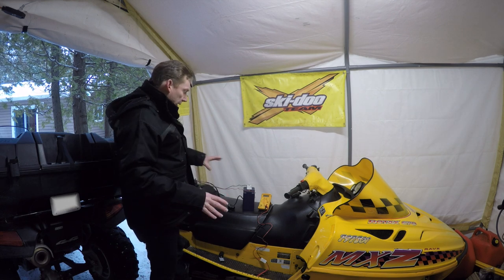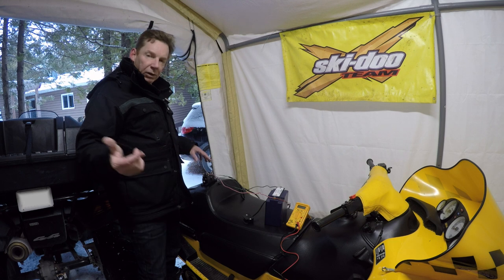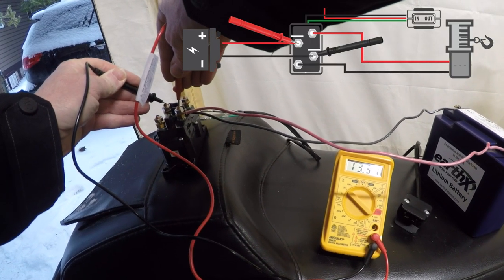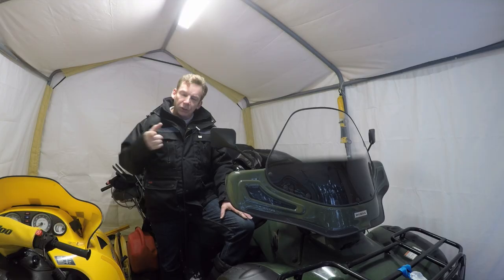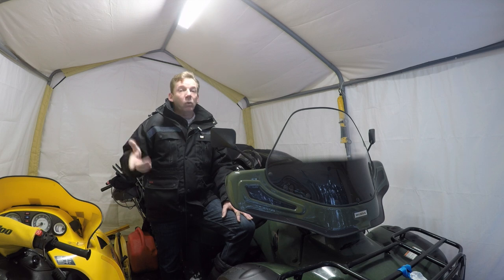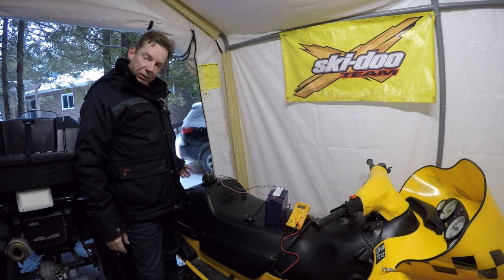These components are going to be installed, but you've got your battery, your solenoid, and your switch. The first thing you want to do is check the two terminals where the lines come in from your battery. Regardless of where your switch position is, at this point we're in front of the switch, so we should have about 13-point-something volts across these two. If you don't have 12 volts getting to the solenoid, that's your problem — visually inspect the wires between the solenoid and the battery, double-check those connections, or use your multimeter to check each wire for continuity.